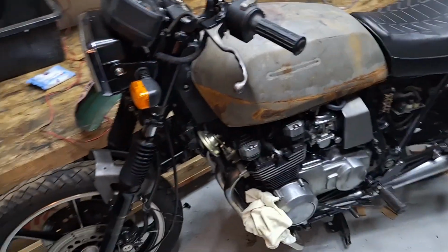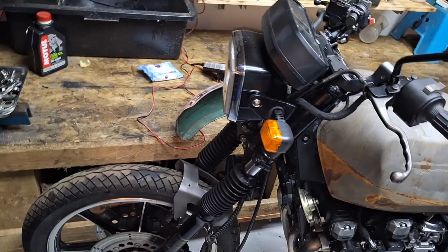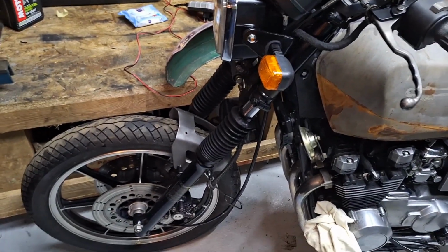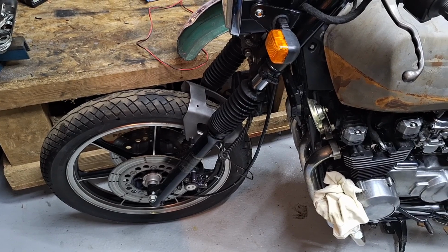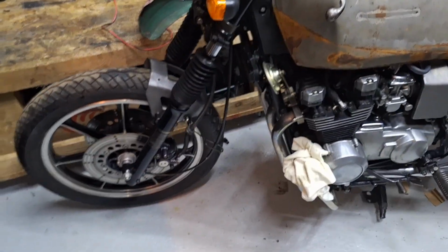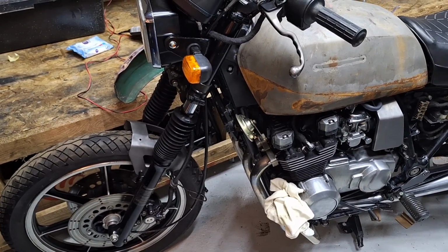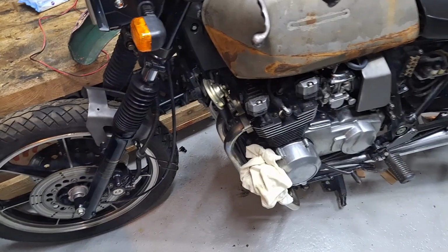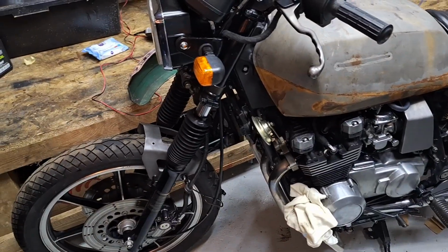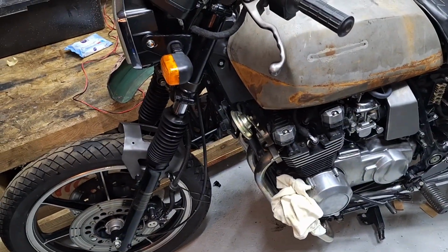And I think I have an idea why that's happening, because when you don't have the functional valve on the forks, then when you brake, the forks go down. With the functional valve you will have some atmospheric pressure to hold it up a little bit, but without the valve they simply go pretty steeply down and push out some oil. That doesn't concern me because it was just a small bit of oil, so I will not do anything here.